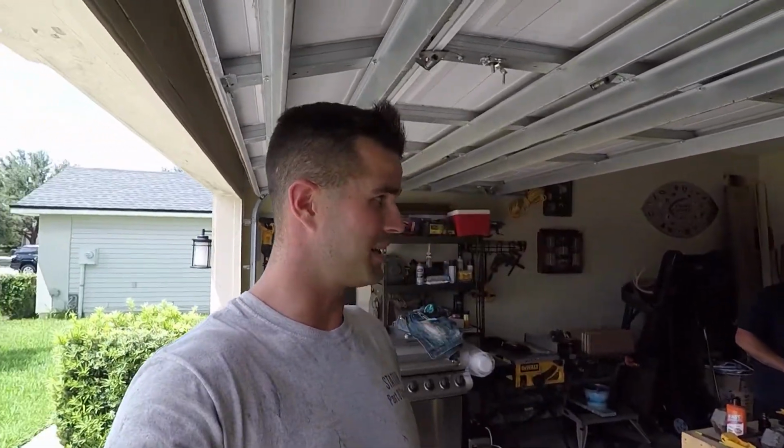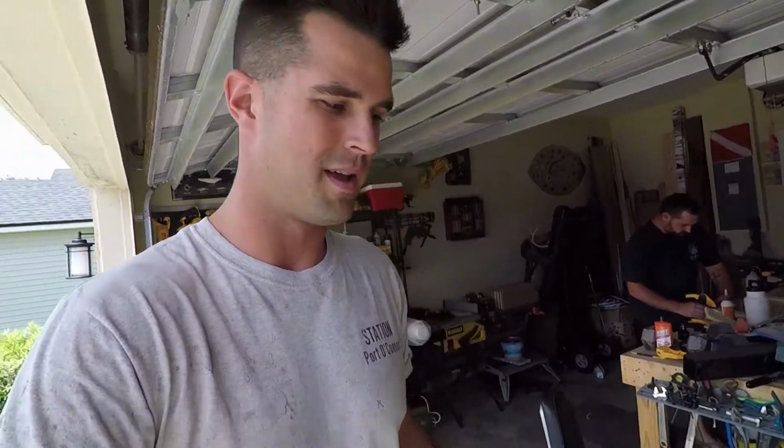I'm at my buddy's house, Jeremy McCann. I went to dive school with him many years ago. He's letting me use his garage and his tools to do an oil change on a 2006 Kawasaki Vulcan 1500. It shouldn't be that hard. All it is is draining the oil out, getting the old oil filter off, plugging it back up, putting the new oil in, and putting a new oil filter on. So we're going to go through the steps and the processes of how to do that, and show you the best way to do it.